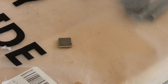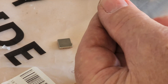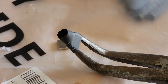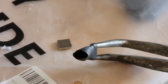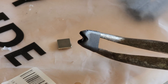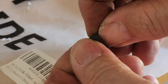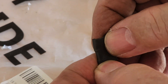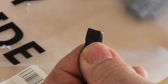So take yourself a little bit of heat shrink — you're gonna have to stretch it. You're gonna have to come up with a way to stretch it. I had this pair of pliers — I'm just using them in reverse to spread the heat shrink. This stuff will bounce back to its original shape if you let it, so you gotta give it a stretch. Stretch it out, slide in your heat shrink. If you don't get it in there pretty good, when the heat shrink shrinks it'll jump right out of there on you. But then you can give it a little bit of a trim.